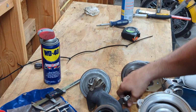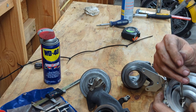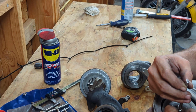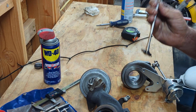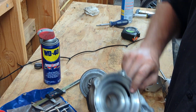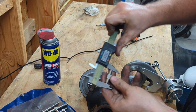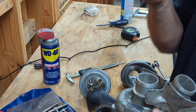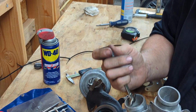Come over here on the compressor and verify it. If you haven't been following along, that compressor wheel I showed you with the extended tips, I'm actually machining, yeah, that's the one I dropped. Machining the 3.5 compressors, 37.3, to accept that wheel, because that's a 40 millimeter instead of 36.